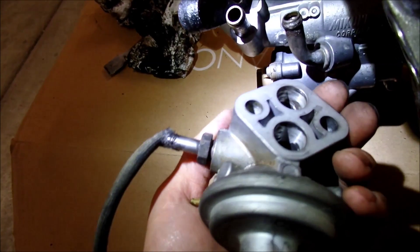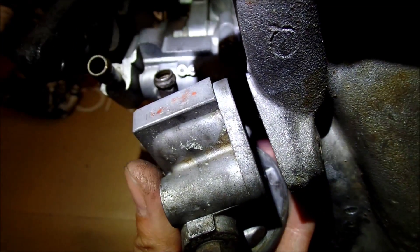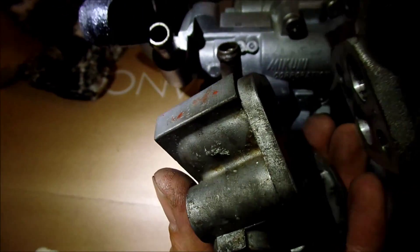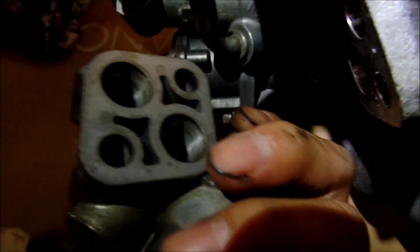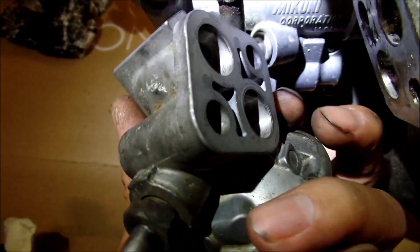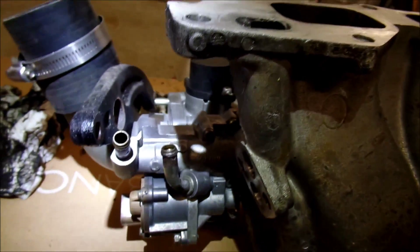This wonderful device that I absolutely hate. The valve opens here on the EGR, and the exhaust gas comes out through here, through this other runner, goes into the intake runners — and that's how your EGR works.